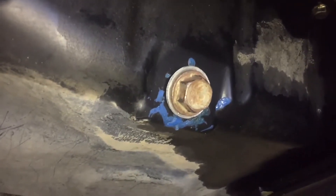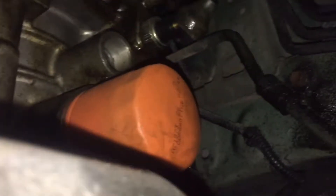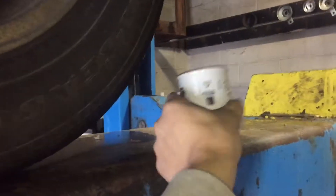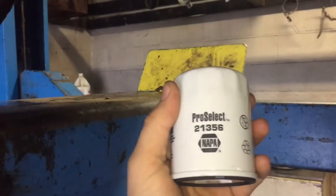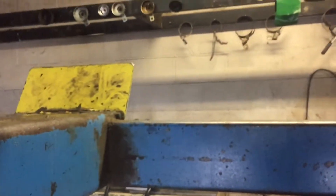Alright guys, here's the old drain plug right here — it's going to be a 17mm. There's a CV shaft right there. That orange up there is the oil filter. I have the replacement filter here because we carry NAPA filters, and the NAPA filter number will be 21-356, as you can see.